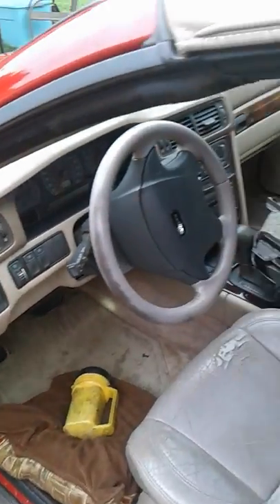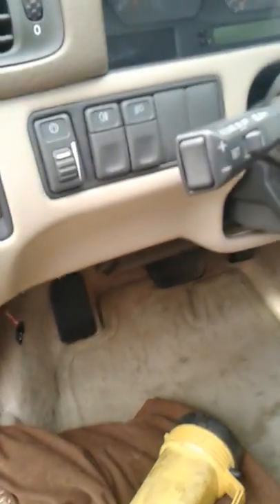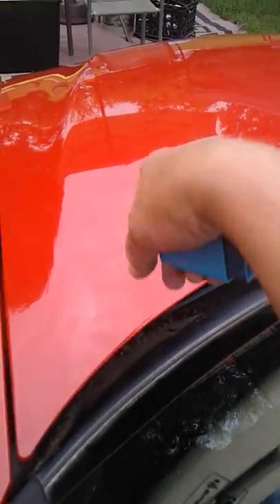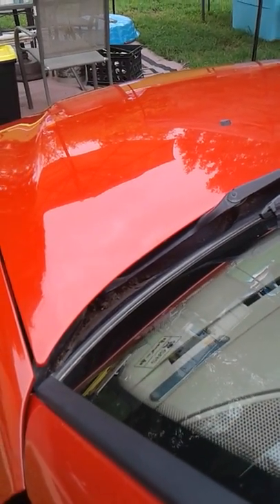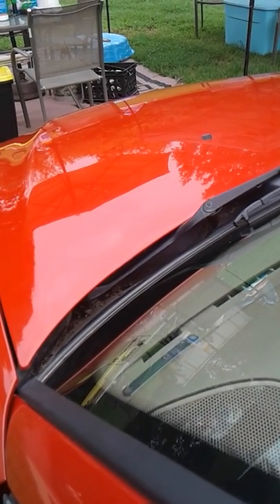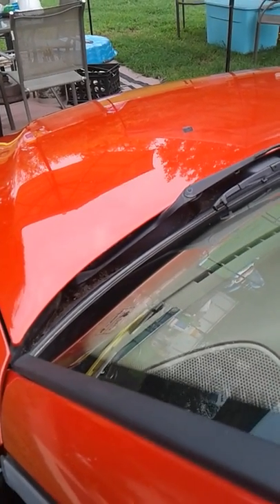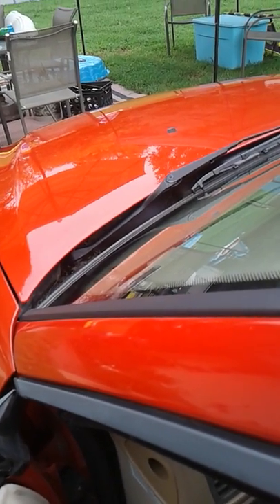The only problem is because the hood doesn't work, there is a sensor. You can see the button right there between the STC and the info — that little thing with the picture of the car constantly chimes because the hood's not operational. Under the hood right here is a relay box. Number 35, I believe, says hood. When you disconnect that little 10-amp fuse and just pop it out, the chiming stops. However, so does the operation of all my windows — it doesn't say anything about windows for that fuse, but yes indeed your windows won't work, at least if you have the same car. So I put that back in.